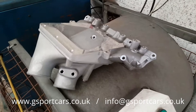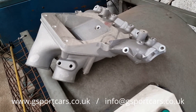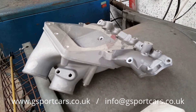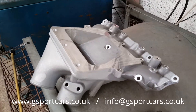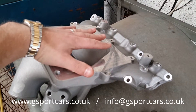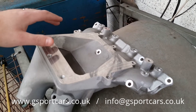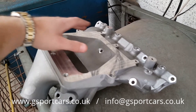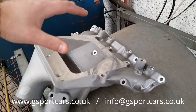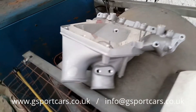To solve that, Ryan has purchased this Merc Racing custom inlet manifold delivered over from the States. Basically, with an adapter plate that we're going to make in-house, the adapter plate bolts on here on the top. This manifold is designed for a different charger — I think the M62 — so we put the adapter plate on here and then Ryan's Jackson charger will bolt on top of the adapter plate.